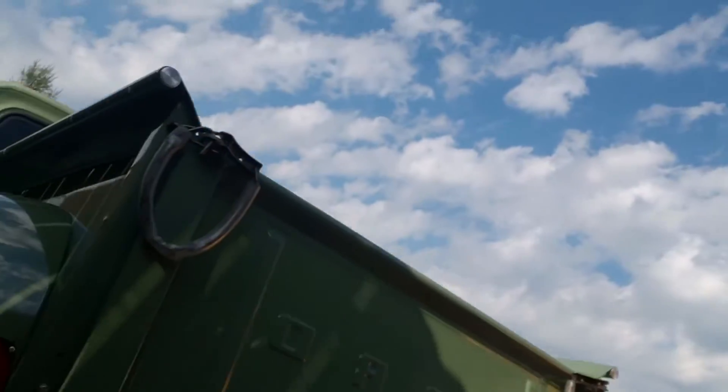Last night my wife decided she wanted to drive it somewhere. Previously I'd checked all the lights and everything seemed to be working fine. But I noticed as she was pulling out of the driveway with her headlights on, she hit her brakes and the right tail light was having an issue — the left tail light was working perfectly, but the right tail light would dim when she hit the brake, and the backup light would come on. Very strange problem.